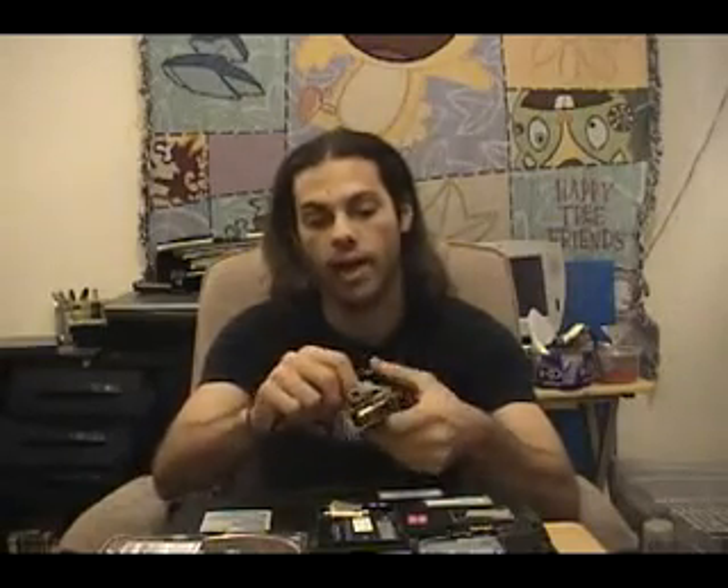This is where the electronic stethoscope comes in. This is nothing more than a basic audio amplifier with a built-in pickup coil. You can actually go and buy a telephone pickup coil and add it to your own home-built or purchased amplifier. This is just a patch cable for my camera so you guys can listen. I've got a couple of hard drives here — I'm going to grab the power cable and power up some of the drives to show you.